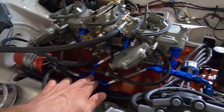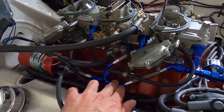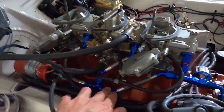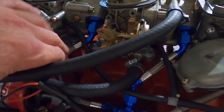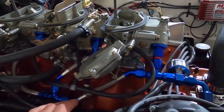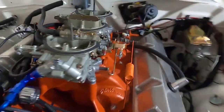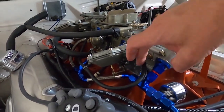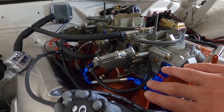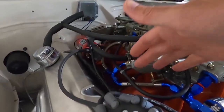This is actually a kit from Promax — I'll include a link in the description — and I was really happy with it. Initially I was going to make my own AN lines, but for $175, considering how much all the fittings are if you were to make your own, I'm really impressed with this setup. There's very little space in here; I don't even think a regular AN system would fit. These are like an extra low-profile AN setup. It also comes with a pressure gauge, which when you're tuning the carburetors makes it a lot easier — much more simple to remove a carburetor if you need to make a change, rather than wrestling it away from steel lines, because you've got some flexibility.